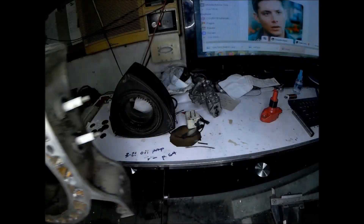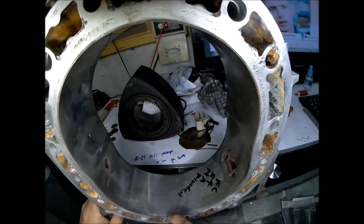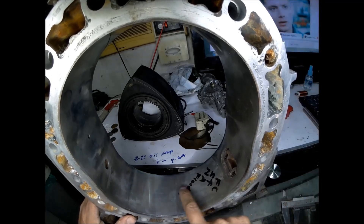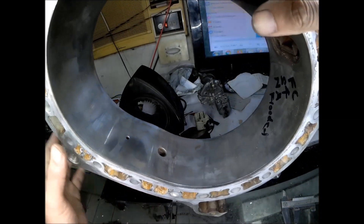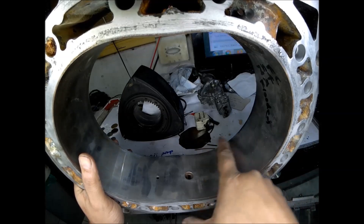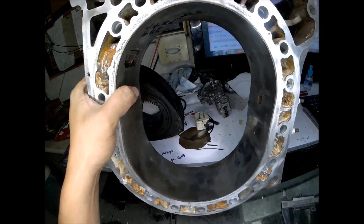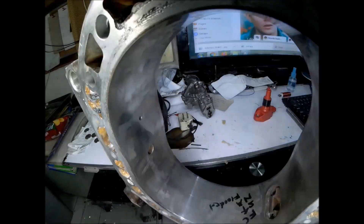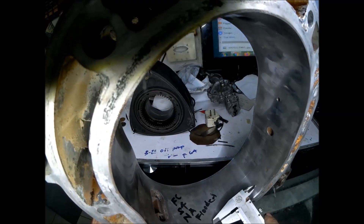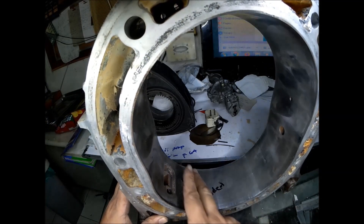Also slight chrome flaking here. And for the rear rotor housing, very slight wear also here. For the rear rotor housing, no wear on the other end, no wear at the center part. Slight wear here, nowhere at the center. Slight wear also here at the other end. There's also chrome flaking here, but it's just around 1 to 1.5mm of chrome flaking at this end, and none at the other side.